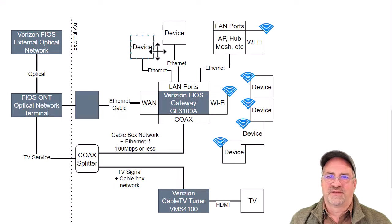In this setup, I've actually got a couple of devices in the closet — a hub — and I've got a wireless mesh or Wi-Fi repeater sitting upstairs on an Ethernet cable from this hub, and that's got its own LAN and its own Wi-Fi. The wireless devices in the house can either connect over Wi-Fi to the main gateway or they can connect to the upstairs hub. It's also worth noting that a smart TV or a tuner box just appears like any other device — they can be Ethernet connected or Wi-Fi connected.